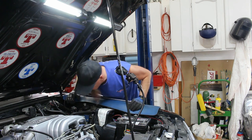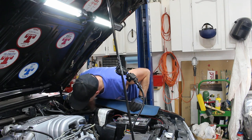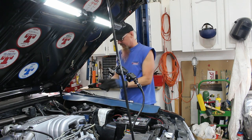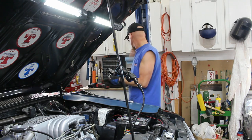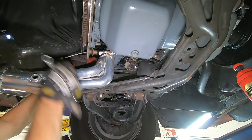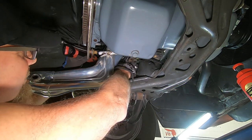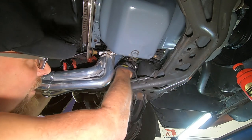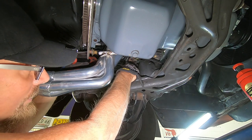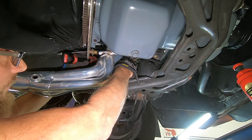And that's the sound of something falling into the abyss. All right, well, now we've got to do the rag joint end. We're going to have to do the rag joint here in two halves. We'll get this bolt. Well, that wasn't very tight at all. And then after we pull this one out, we'll turn the steering shaft 180 degrees and then we'll pull the other one out. Then we can drop the steering shaft out. So let's get this one out.